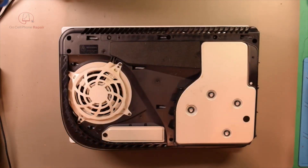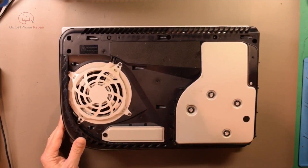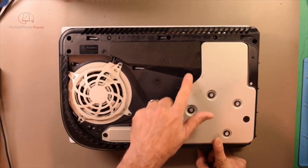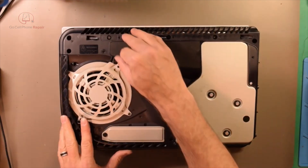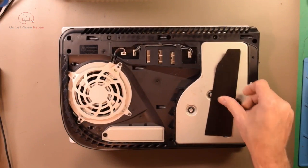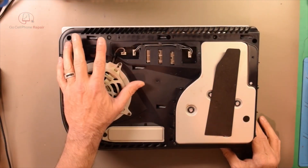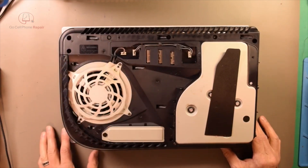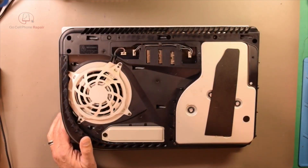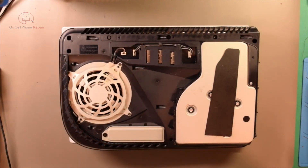I was going to pull the board out and take a look, but as soon as I took this panel off I noticed something. We are missing a warranty sticker and this one's kind of off-center a little bit. So my guess is this has been worked on before. I don't know what they did — I'm kind of concerned about what I will find on the inside. But when you have ground all the way across the HDMI port, you've got to wonder what happened. So I'll go ahead and pull this the rest of the way apart and take a look under the microscope.